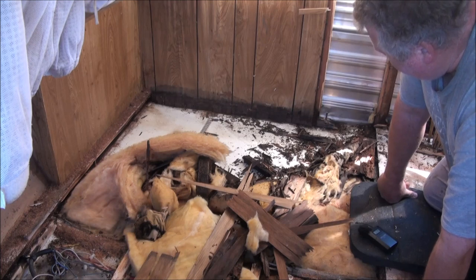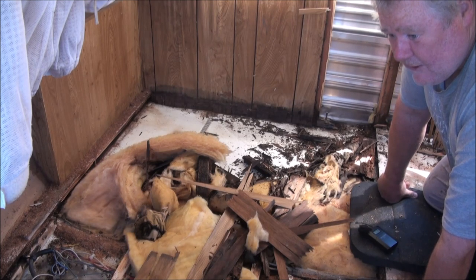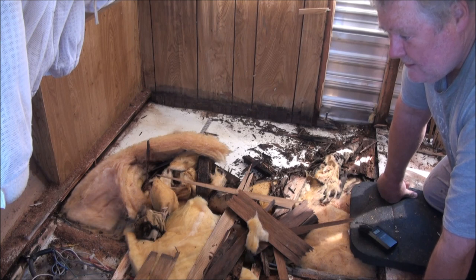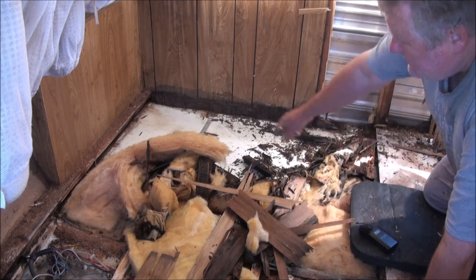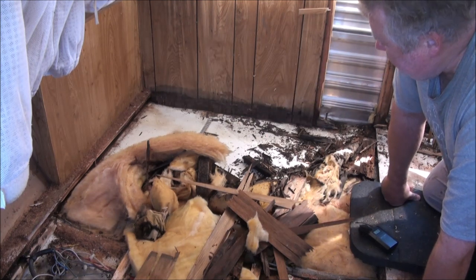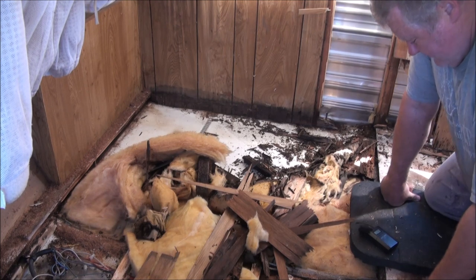This is a half-inch flooring, as stated. I'm going with a 5/8 flooring. It's a tongue and groove flooring, so it'll go together real nice. And the distance between these two walls is about 7'4". So I just cut a little off the end of each of my flooring panels, they're 4x8. And they should go right in here. So I need to do some more. I need to get the end of that plywood out of there, etc. This is going to be a hell of a nice job. So that's what today's going to look like.